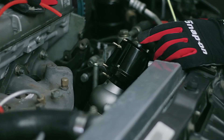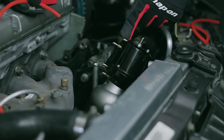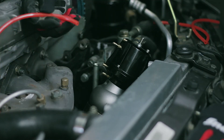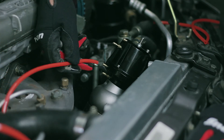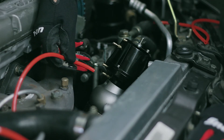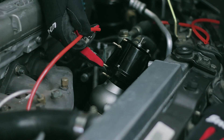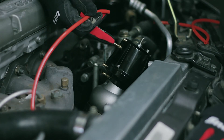The Synchronic wastegate has four different ports. From top to bottom you start with A, B, C, and port D. So let's imagine for a second that this is your boost source. On the traditional wastegate you would just apply it to one port and depending on the spring you have in the wastegate you're going to make a certain amount of boost — let's call it 10 pounds. On the Synchronic wastegate, ports C and D down here open the wastegate, and ports A and B up here close the wastegate.